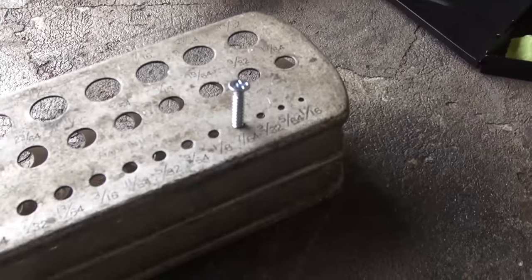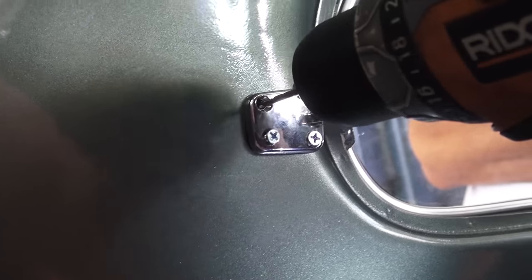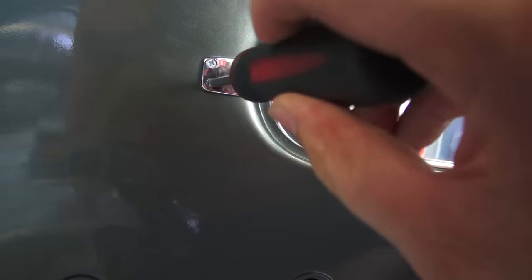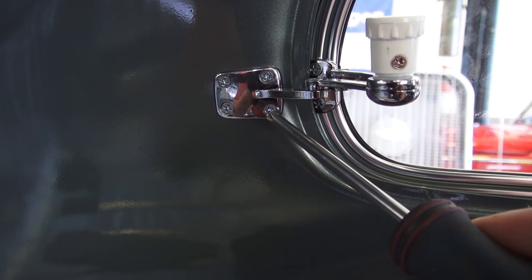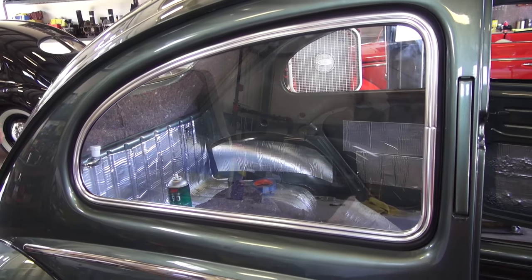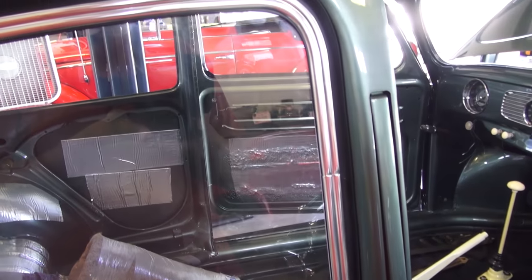Here are the #8 sheet metal screws they give you and the 7/64th bit we're going to use to drill the pilot holes. I've drilled two holes already. Set it up, catch the two screws, then drill the other two holes. Do not force the drill too much — if you do, the bit can punch through the outer wall of the beetle and create a dimple in the paint. Tighten the screws using a crisscross pattern — don't go all out on one screw at a time. Once closed, you should get a nice snap. Come outside and check that the seal is flush with the body.